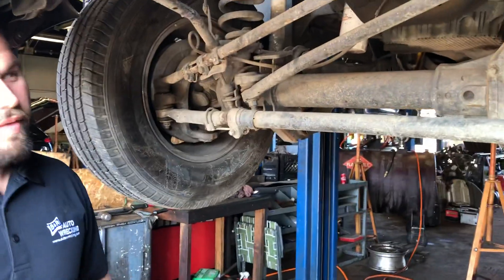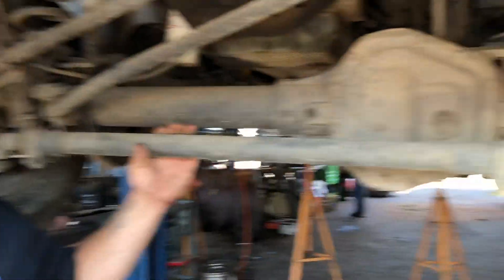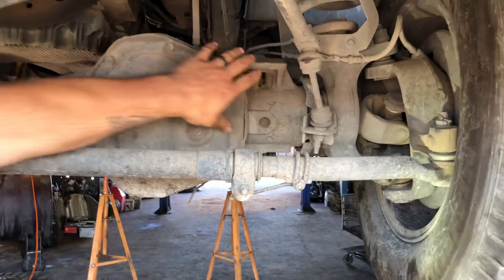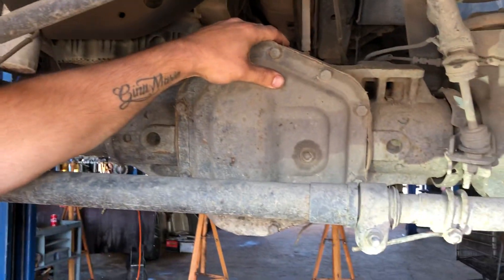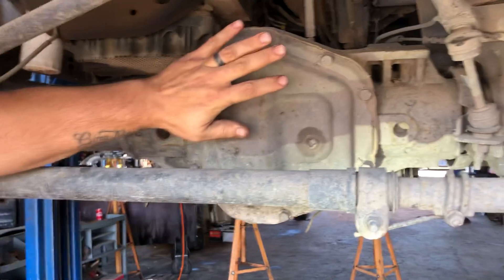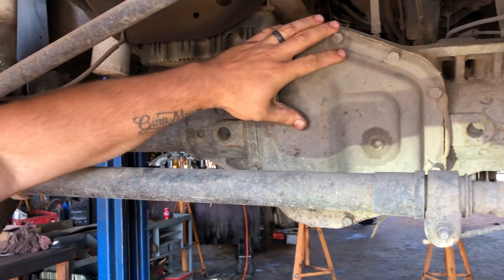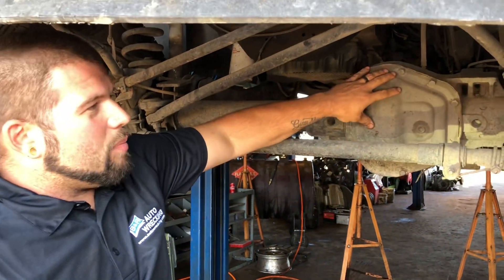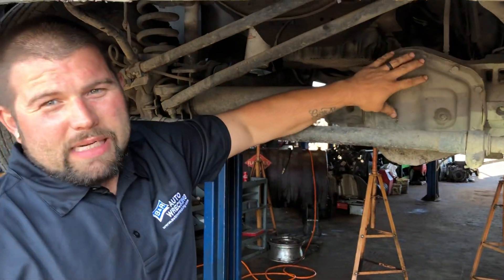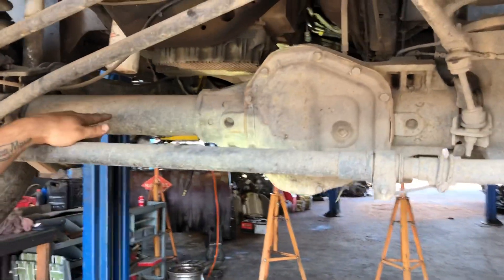So JJ, want to tell us a little bit about this F-350? What we're going to show you first is a solid front axle setup. As you can see, the axle is built on a single tube with the third member somewhere in the middle of the tube. This is where the gears are kept — this is your differential on this vehicle. The main differences between an IFS and a solid front axle are going to be your steering components and the way that the carrier is held inside the vehicle. This is on a solid tube.